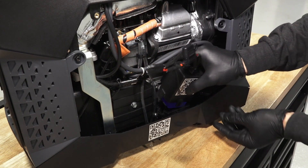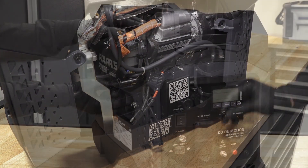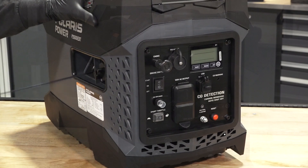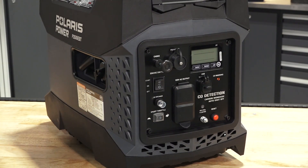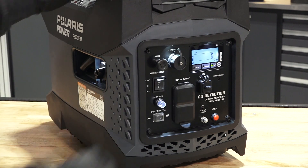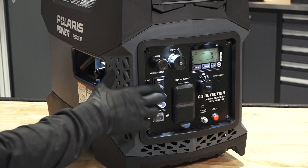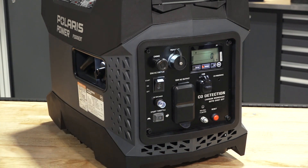Reinstall the battery per the owner's manual guidelines. Follow the recommended start and usage procedures listed in the owner's manual and on the help center website. Always start the engine outdoors in a well-ventilated area. If the engine was fogged during storage preparation, it may smoke briefly at startup as it burns off the excess oil on the cylinders.